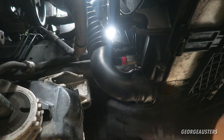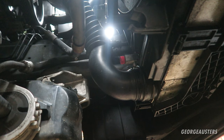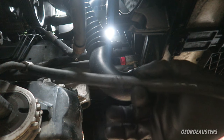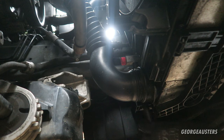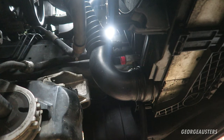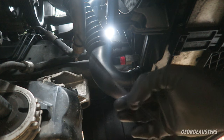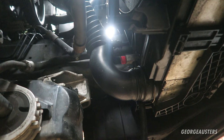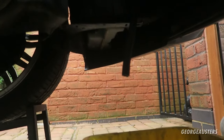There is actually a drain below it. You can either just let it drain from here and risk it going everywhere and spraying outwards, or you can go ahead and connect a hose. I just have this hose right here — it's a pretty tight fit, but because the coolant is going to come out with some force, I'm going to put a zip tie on it to hold it in place, so I can drain the coolant into my bucket.